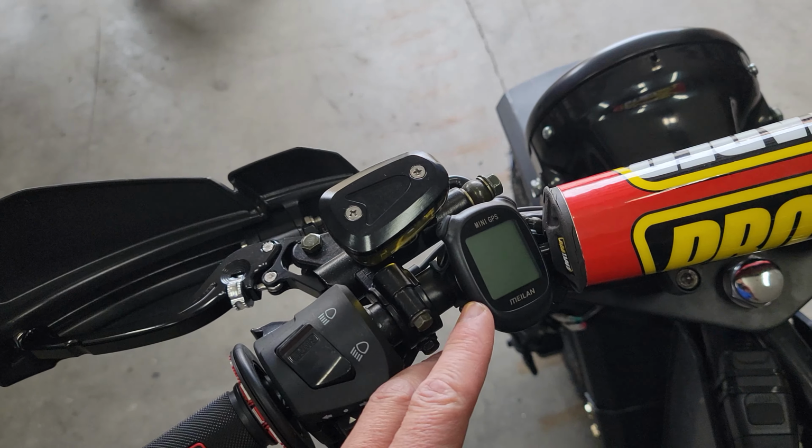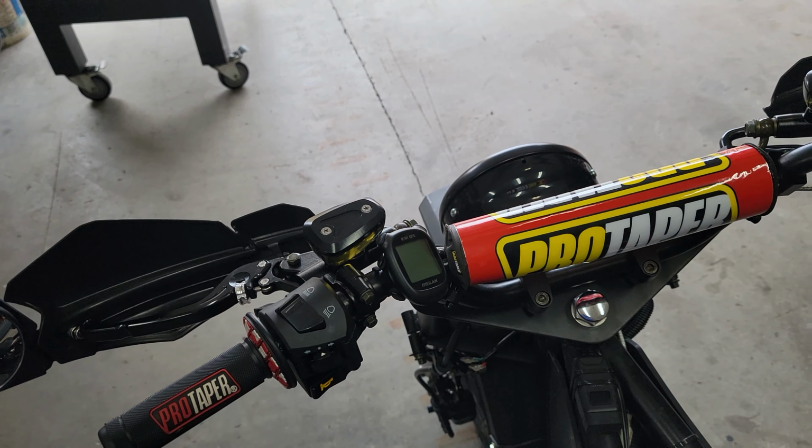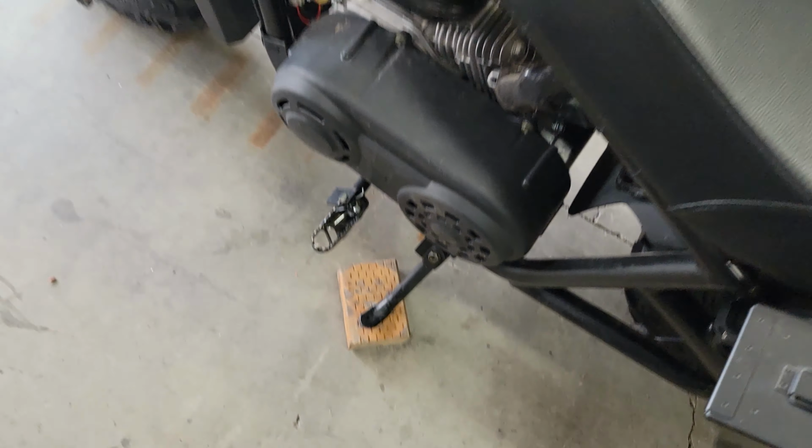This little GPS thing, this is awesome. I will leave a link in the description one more time for that. It was in a previous episode of this build series. But it works great. You can read your speed right from that screen. The charging system works great. I burnt up one of the cheap tiny rectifiers, and then I put this bigger one on that I found on Amazon. I will leave a link to it, and it's handling the amperage just fine.